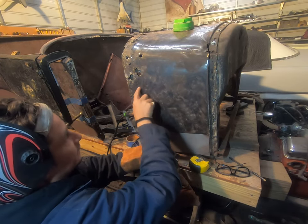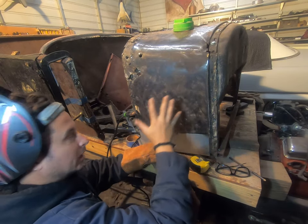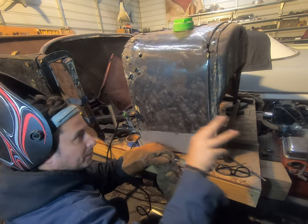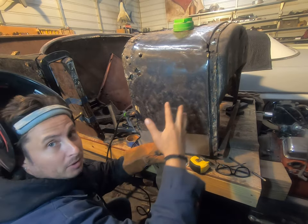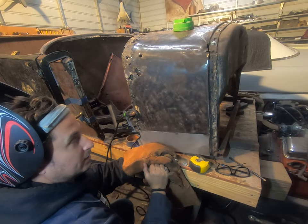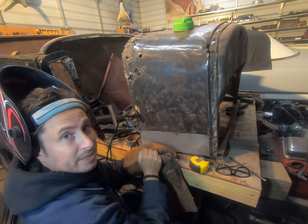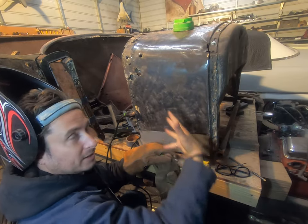The simple reality is, I don't know if you guys can see this, but this metal does have a lot of pits on this end and I'm kind of okay with that, but that means some thin metal. Again, everything needs to be seen through the lens of what the final product is. Trying to replace as little of the sheet metal as possible, because the pitting is part of the age. If this was going to be any kind of showier finish than this, then we'd be doing this a little bit differently. Probably cutting in a little more to the good metal, or really, we'd just be backburnering this cowl and working with a better one to get that product, and then save this cowl for a project like this.